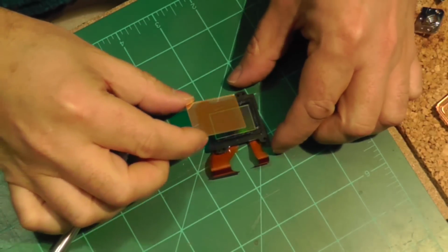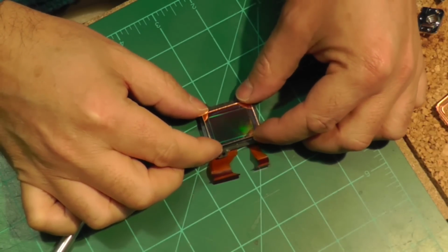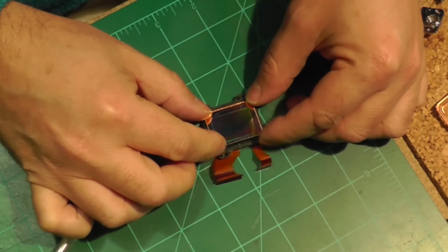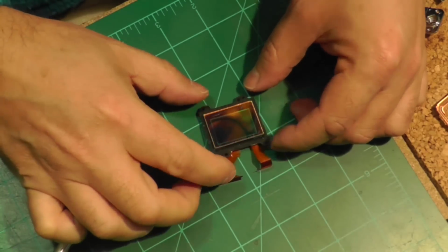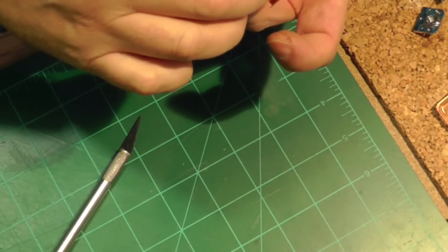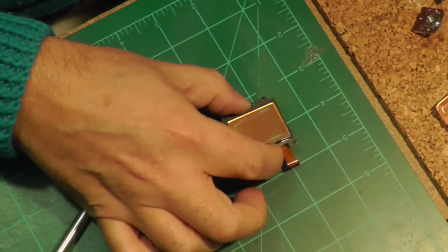And what I'm doing now is I am replacing that filter with a color infrared filter. So this will allow near infrared light to pass, as well as blue and green. And that's what you need to produce color infrared images that eventually you can use to determine vegetation health.